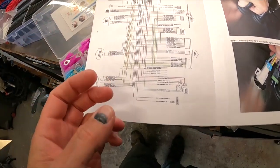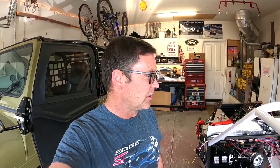As I said, I'm not going to have a start switch in this. There will be no start switch as far as a key or anything. There is no key in this. But I do some electrical things to it. Let's just say that I don't want to get into it because the car can't be stolen unless you know what switches to hit in what order. And I'm not going to get into what I do because if anybody watches this video, the car is then very easy to steal. But if you don't, the odds you get in the car started are pretty slim to none. And I can always take the battery key out too, which then will kill everything in the accessory, ignition, main power to the car. The starter's still hot because the power does run through the starter.